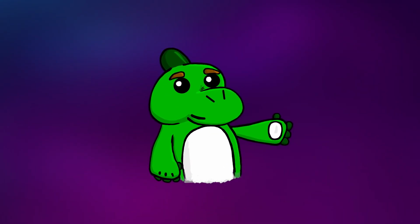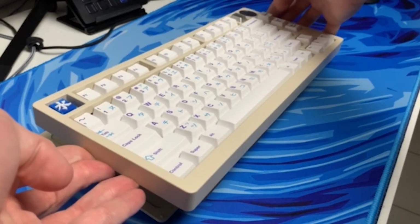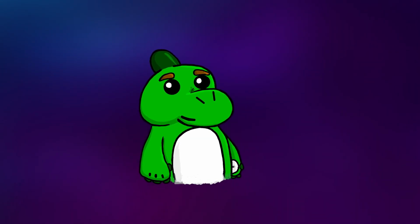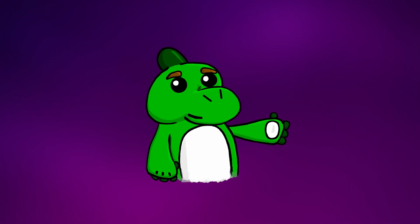Basically, they interfere with switches, so once you solder the switches into your keyboard on the outer areas near the screws, while lifting up your top case, it will not be able to come up if you have your soldered switches in there, which is fine because you could always just take up the entire top configuration and do whatever you need to do with the case like that. But that does mean if you're trying to separate all 3 parts of the case, you will need to desolder some switches.